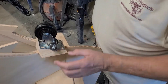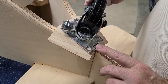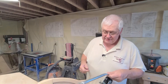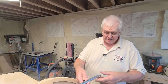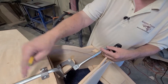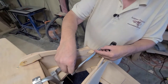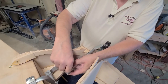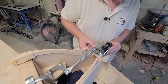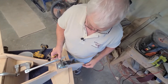The tail wheel is attached. On the tail wheel you have two holes in the front and two holes in the back. The two holes that are narrowed together go to the back. Right now we're going to put our control rod to the tail wheel to the bell crank. You got to make sure your control stick is centered. Put it on there with one nut — just hand tight is fine. And you want to center your tail wheel to the rudder so it is straight forward and aft.